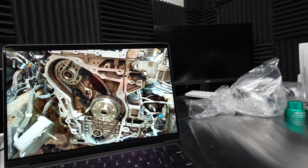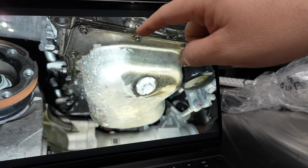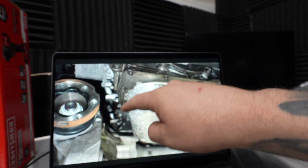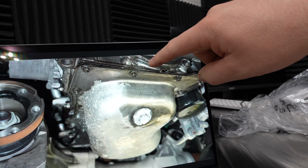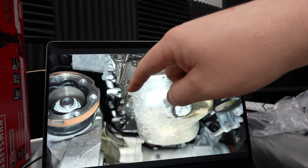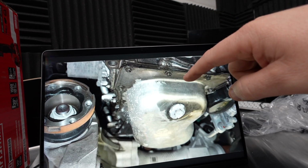Now, for those of you wondering about what other oil leaks there are, let's get into those. This is your engine oil pan right here, and you can see that there's actually oil residue all along right here. Now, a common area for the engine oil pan to leak is just right up along the sides and the back side. This silicone right here, that is your rear cover. So in determining where your oil leak is, you really need to see how high up does this engine oil go. Now, just because you have engine oil back here does not mean that that's actually the issue.